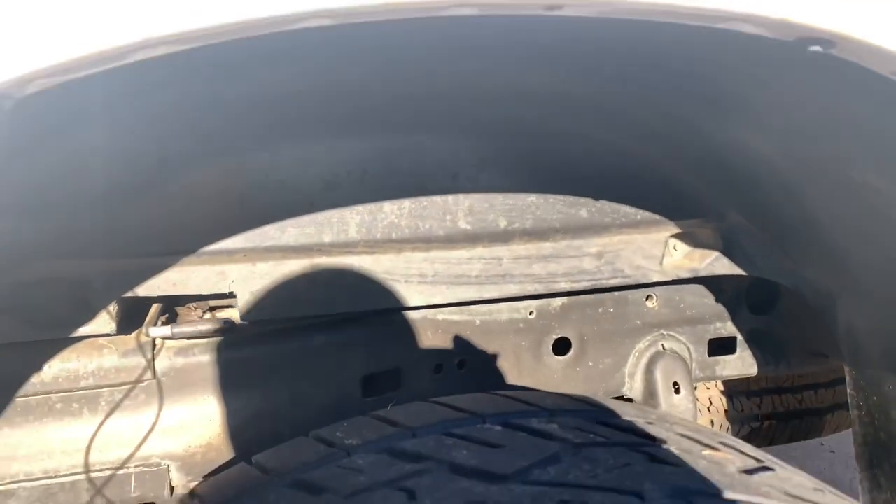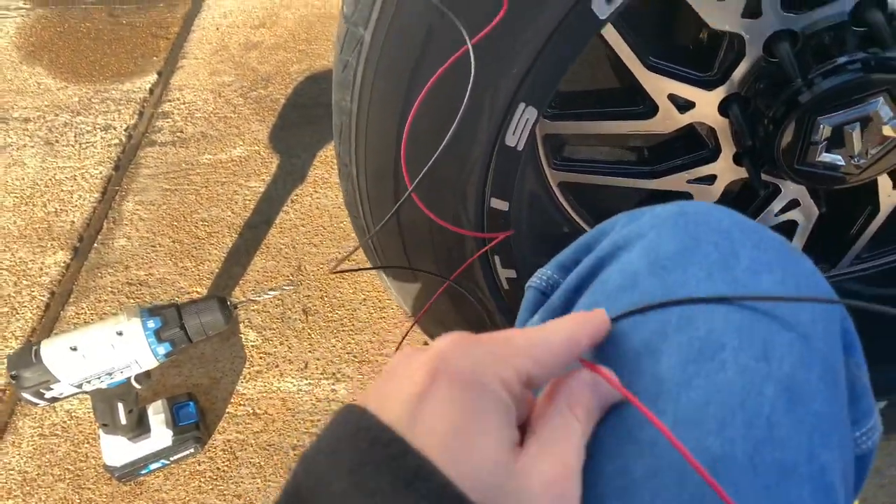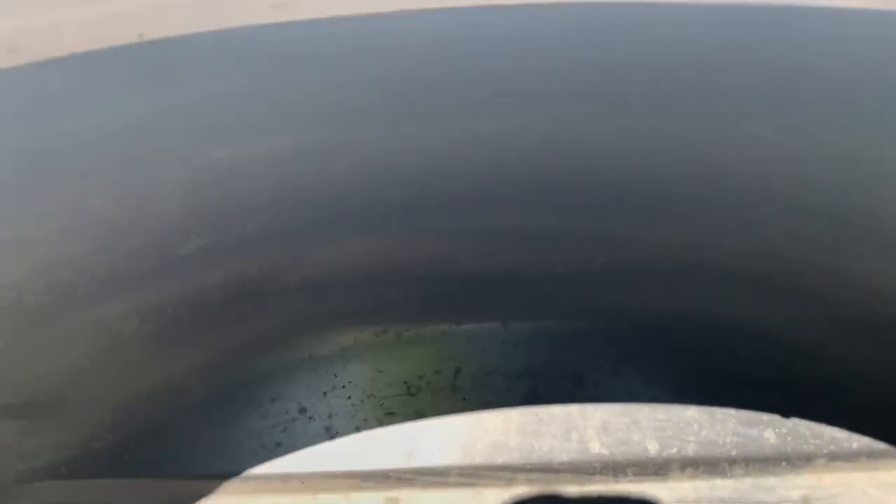In each wheel well there's a spot on the top that faces kind of toward the inside bottom — that's where I'm going to mount each of these strips. I went ahead and put some butt connectors and cut two pieces of wire as long as the truck. I'm going to mount it up in here, poke a hole with a drill, feed the wire through the hole, and then run it down the frame all the way to the front.